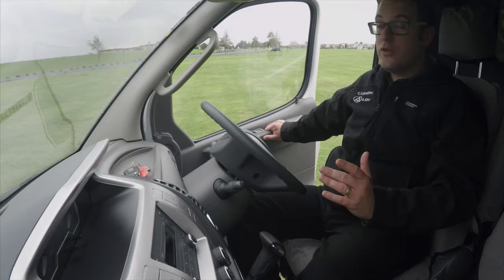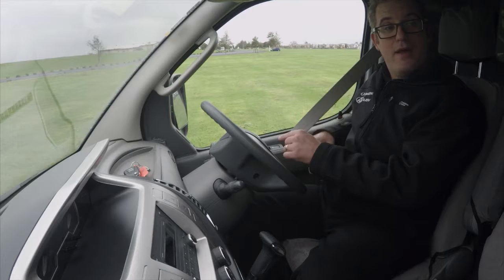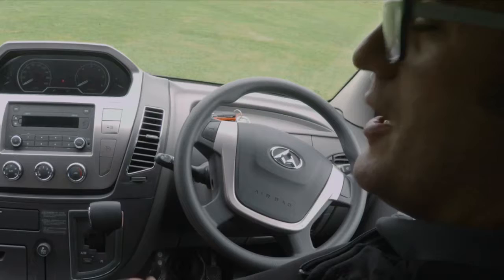There are a few things you need to know before we get underway. All the doors need to be fully shut. If the front doors or the rear cargo doors are slightly ajar, the transmission isn't going to drive properly — it's a safety feature designed to tell you something's not quite right. Likewise, the driver needs to make sure the seatbelt is engaged. The driver's seatbelt has a sensor, so it must be fully plugged in, otherwise the transmission will be trying to tell you something's not quite right.